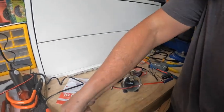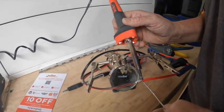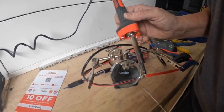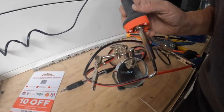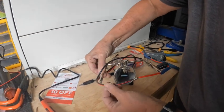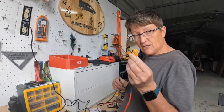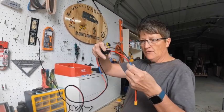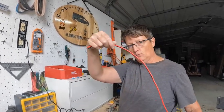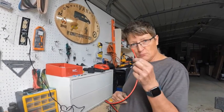Thank God for my four hands. So I'm soldering a fuse onto the aviator plug that goes to the Bluetti that's going in this Transit build. That's probably one of my better solders, actually. So the XT60 goes to the Bluetti. I've got my inline fuse, a 20 amp fuse in that. And then this will go to the fuse panel and I will have power.